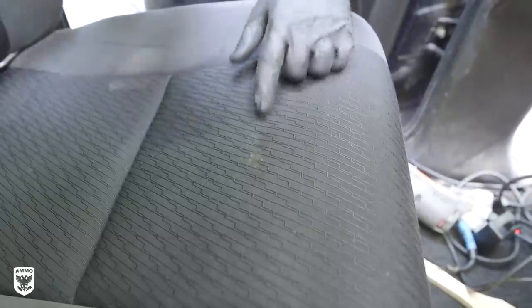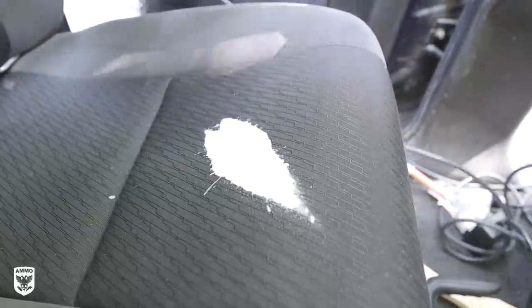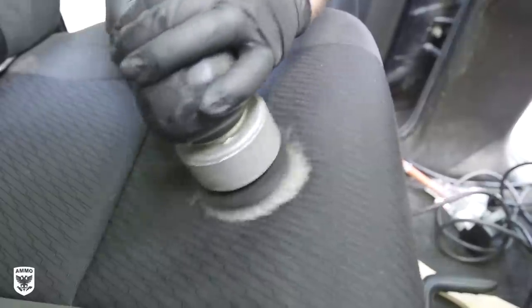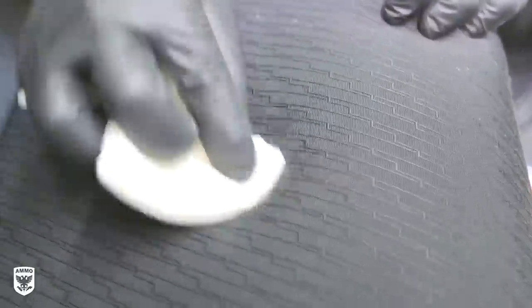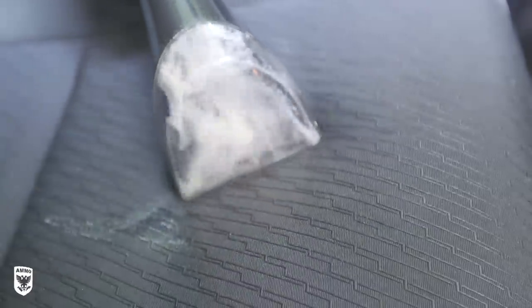Only use a twisting or a scrubbing machine when it's absolutely necessary because the stains are so stubborn and they won't be released, because this is actually going to damage the material or cause it to become fuzzy, nappy, or dreadlocked. Now, if a stain persists, you can use a machine in those isolated areas or even use a scrub pad and your finger for a really aggressive approach when necessary. But in most cases, tamping is actually surprisingly effective and way gentler.